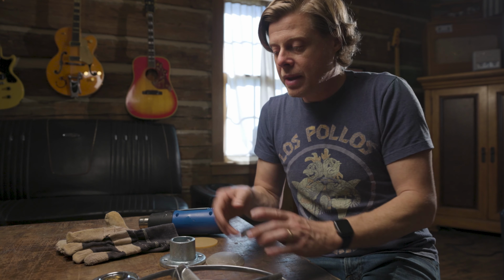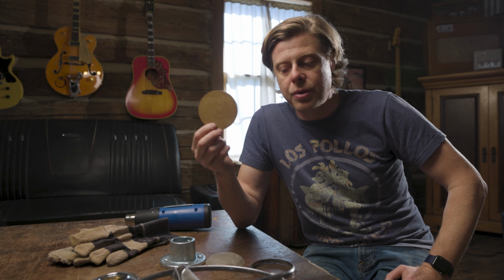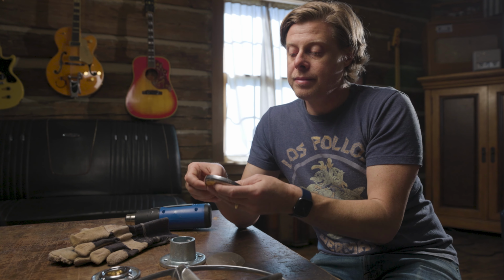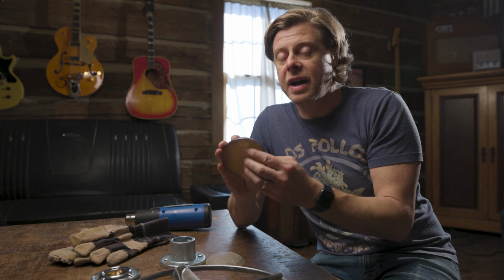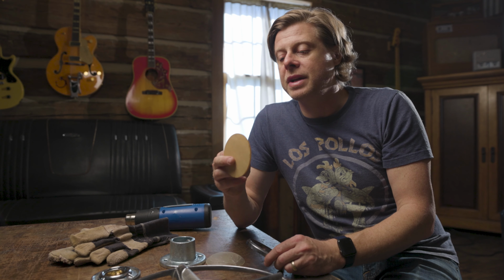And you take your ring, and you're going to need some gloves, a heat gun, and a piece of plexiglass. Now I was able to measure my horn and find this piece of plexiglass already pre-cut online for about $1.50 on, I believe it was eBay, it might have been on Amazon. So you want to measure your retainer ring on the inside and see if you get lucky to find a pre-cut piece. Otherwise you're going to have to laser cut it out yourself, which I have a laser cutter, but fortunately I didn't have to do that. This was available on eBay for $1.50.